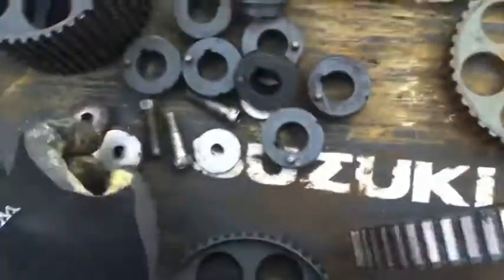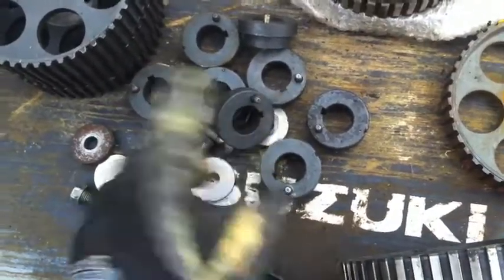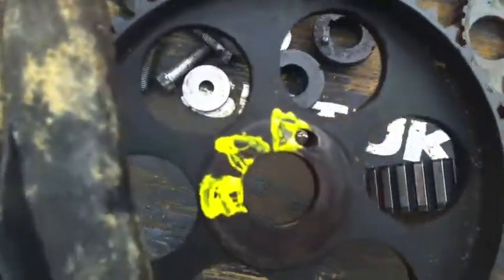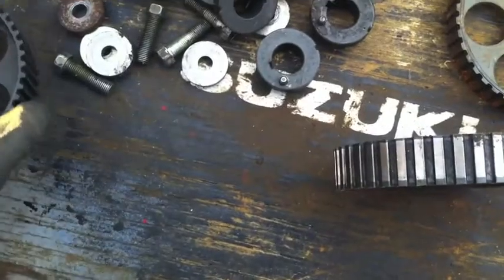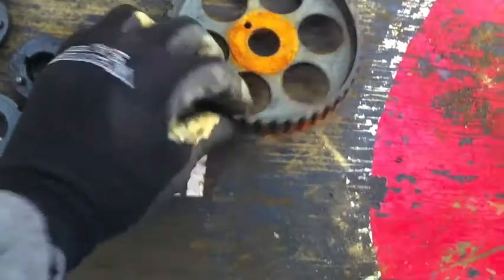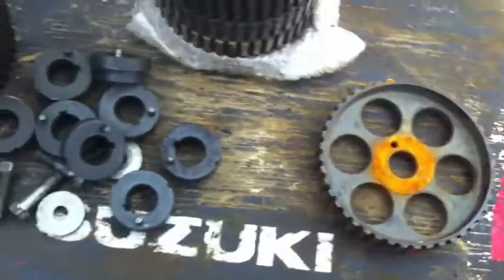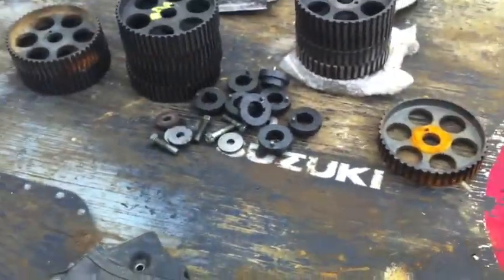This one's bad. This bolt came loose that holds the little dowel pin. That dowel pin started rocking back and forth and it wallowed out that hole right there. That's something that caused the truck to run like it was — it sounded like a diesel motor. And you get a rusty pulley like this, you don't want to use something like that unless you do a really good job of cleaning it up. Anyway, I think that's about it.